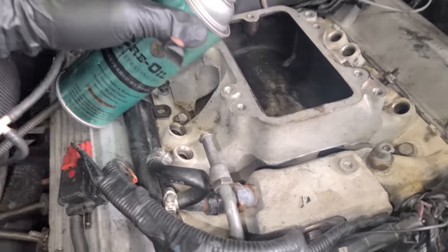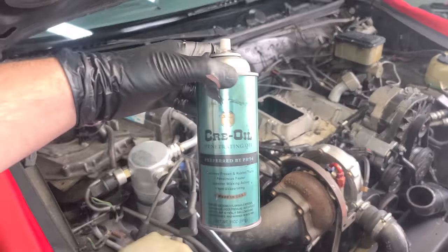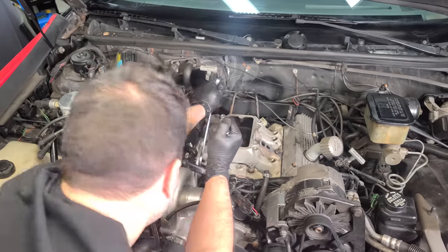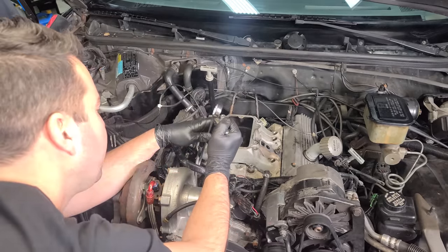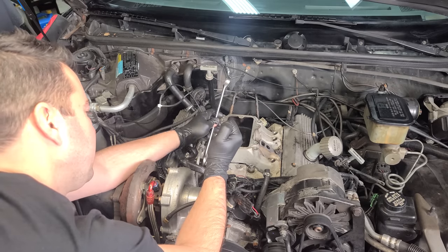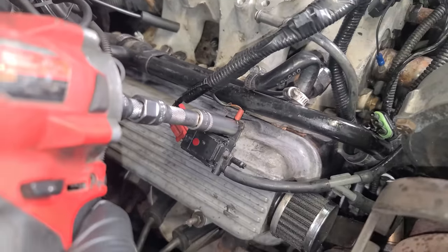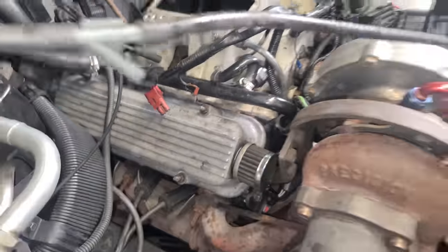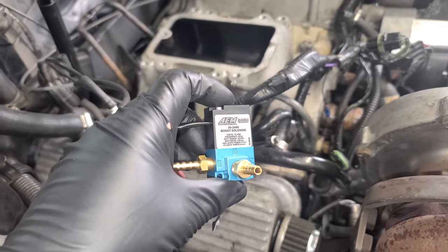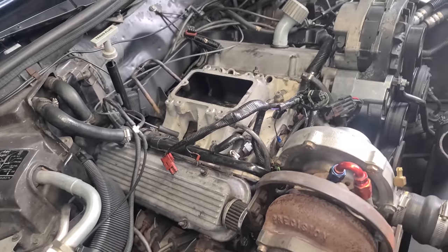The coolant tube wouldn't budge — it was rusted on, so we hit it with some penetrating oil. If you don't have heat in the shop, definitely try penetrating oil before busting any heat out. Here's something else we get to remove: the factory boost solenoid. You can see it goes in line with the wastegate actuator, and we're eliminating it. We're going to be replacing the factory boost solenoid with our AEM solenoid for the true boost controller and hide it to clean things up. We're freeing the valve covers of really anything.